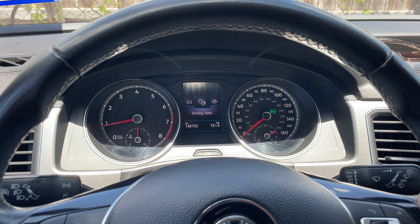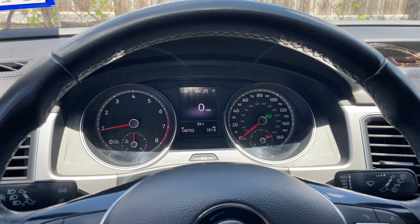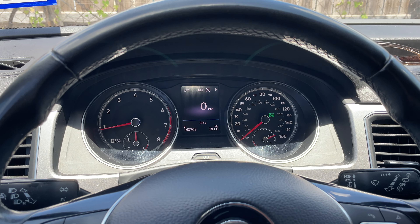You can check that off to turn it off. You can also turn off some of these other ones like blind spot and front assist, but generally I like to leave those ones on. With lane assist selected off, you can go back to your main menu by selecting the over button, and it'll get back to your main menu — put it back wherever you like, like back on driving data.